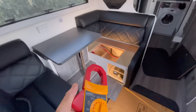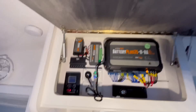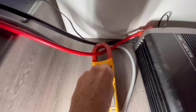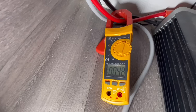I'll show you the problem. We are pulling 46.8 — 47 odd amps — because that GPO upstairs is on, so that infinite loop is active. I'll pull that out. That number will go back to one or two amps standby current. There we go — standby current.